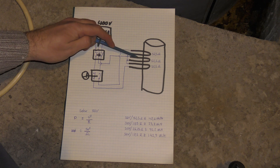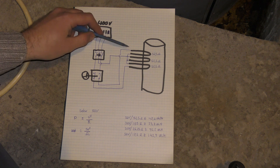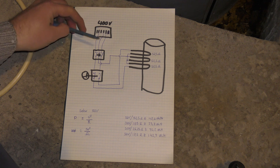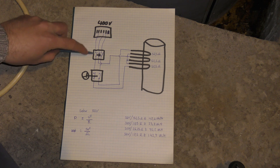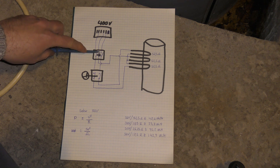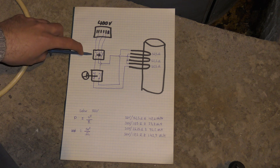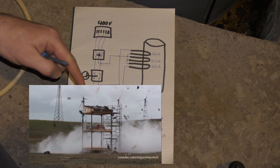Each of these heating elements is short-circuited with one of the leads — all three of them are connected — so only one lead from each goes out to the controller circuit. Right now we have 400 volts, but only three of those power leads go through. There is also a ground wire, we'll act as if it's not there. That goes through the security box — the last-resort box. If the water heater is close to explosion, that will cut off all the power — all three of them go straight through that, just a break connection for all three leads.